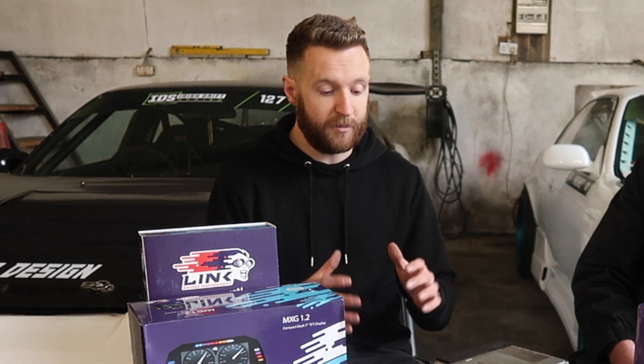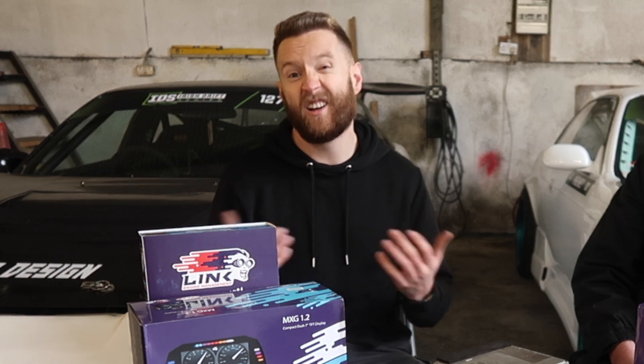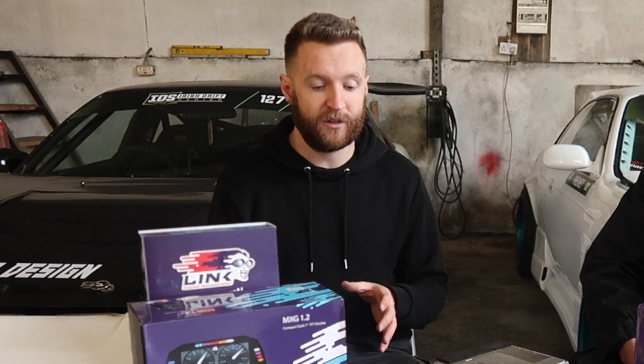That's right — you can do it, and it has been done, but in a lot of cases you'll need an external boost controller. You'll need an external air-fuel ratio gauge or a wideband lambda kit. It gets complicated and it gets expensive, because if you're buying external kits to monitor everything, you almost have the price of a good ECU like this. So then basically, the next step up from a standard ECU is our kind of outdated options at the moment, like the Power FC or the MoTeC ECU that's probably in my car — 15 years old at this point.